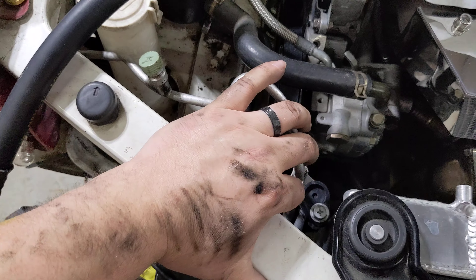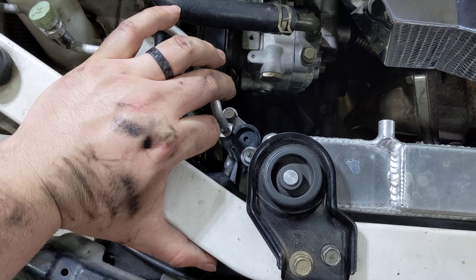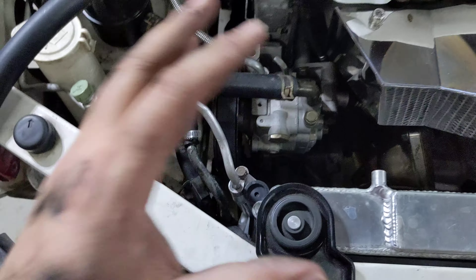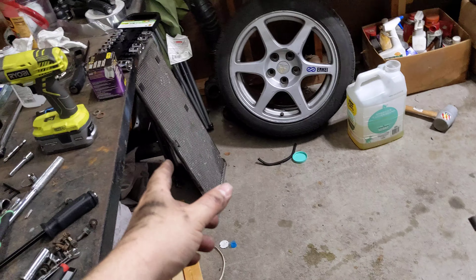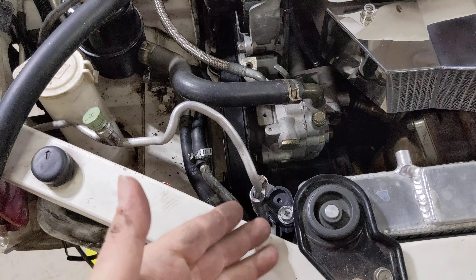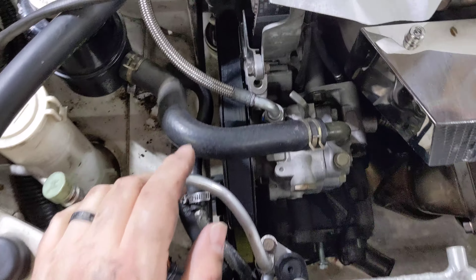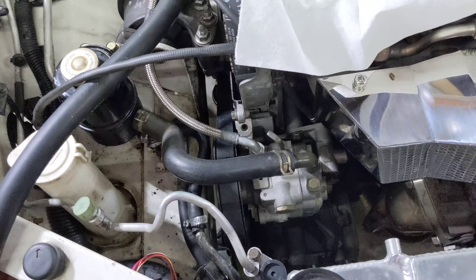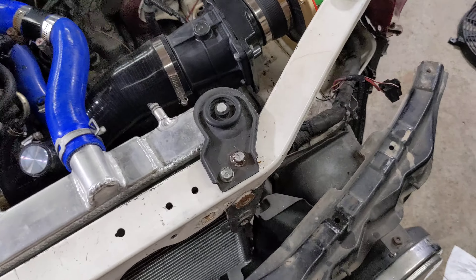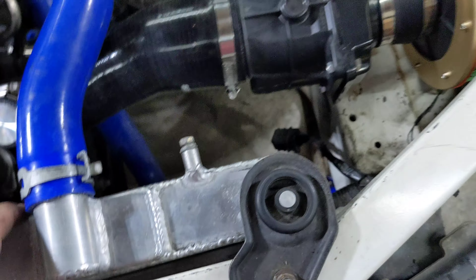I had to bend these lines. This AC condenser — I'll probably link the company I bought it from in the description just so people can avoid it. They had a picture of the exact OEM one I needed with the lines and everything perfect, and they ended up sending me this one. The lines are not right and they were pushed way over so I had to heat them up and push them over like 3 inches. It probably could have gotten damaged in shipping, who knows. But even this was way too close — I had to push it back because it was hitting the radiator.